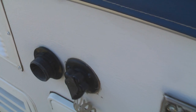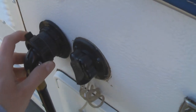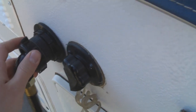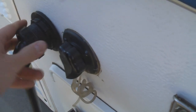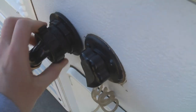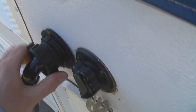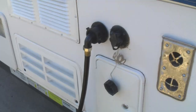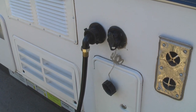Today we're going to talk about how easy it is to winterize your camper. I choose to use antifreeze instead of an air compressor. Because I do that, I want to make sure that my sink discharge outlet has the hose connected to it so that my RV antifreeze will run down to the ground instead of all over my nice white camper.